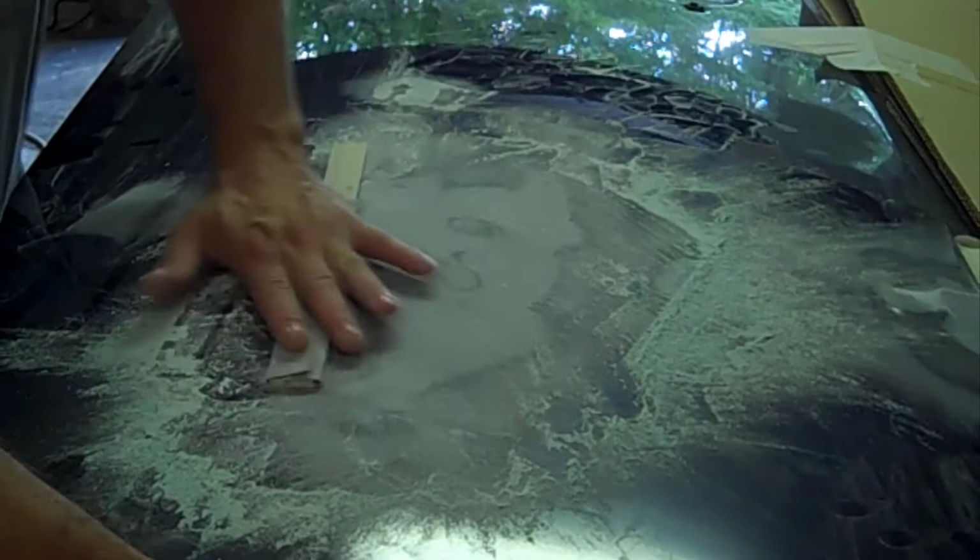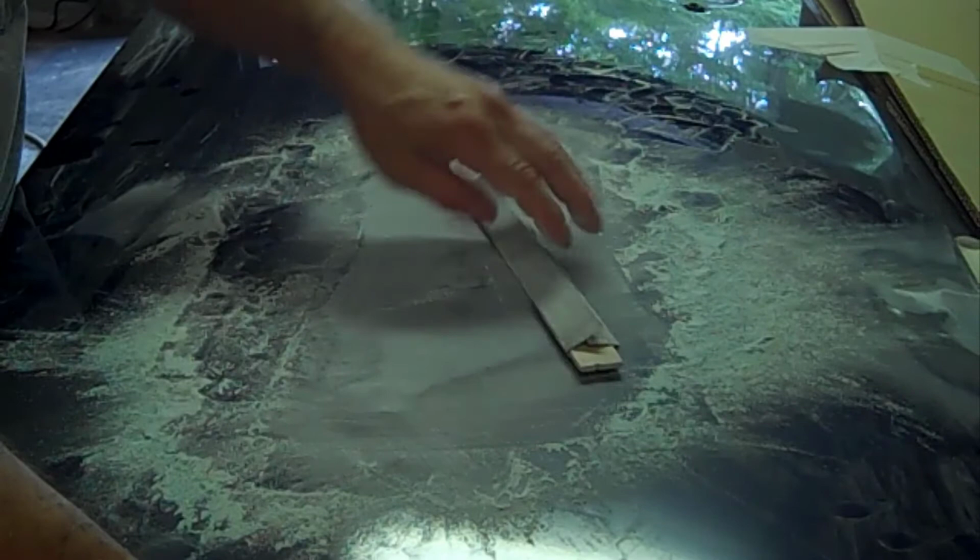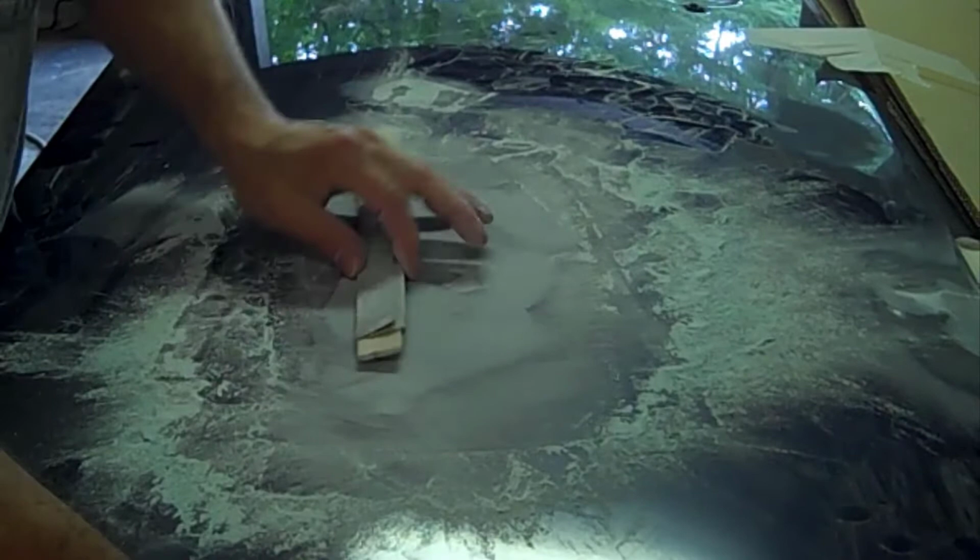And I try to keep my sanding to the confines of the filler or the glass that I'm sanding. So there's no need to put 80 grit scratches all over the entire door. It's one reason why my sandpaper isn't the full length of the paint stick. It's about the length of the area that I'm working. And it's about ready to go to a different grit now.